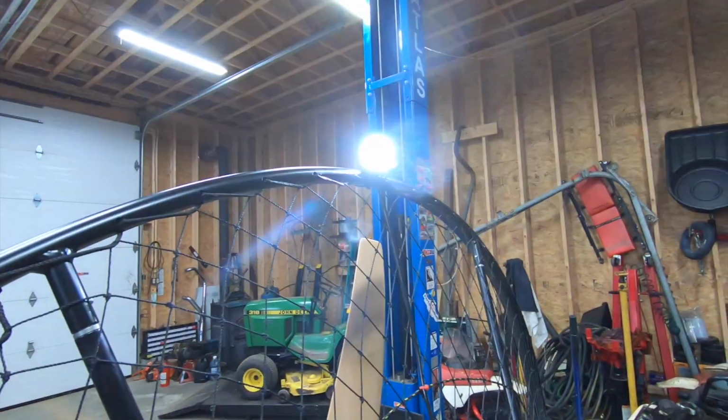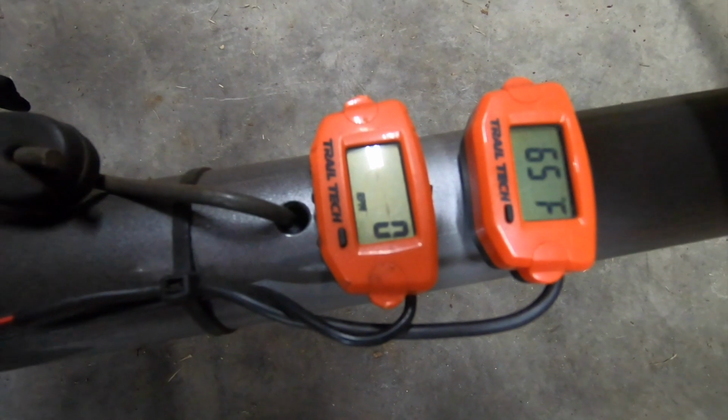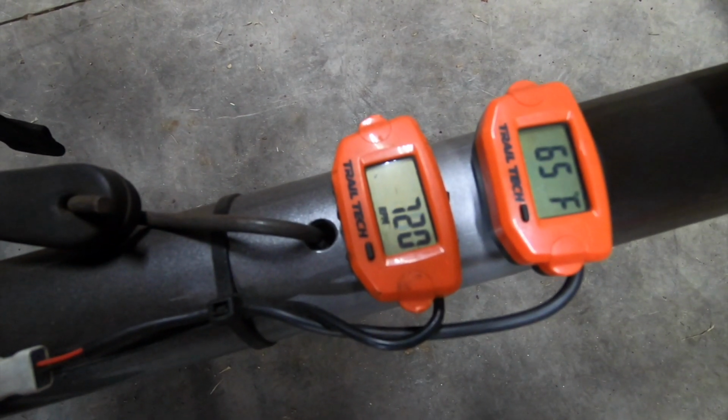Anyways, so I'll show you what it's doing. Plug in the battery. Yeah, we got power. It's been a crank no start. So we got fuel. There's a tachometer. All right, that tells me we got spark, but we got a fueling issue.